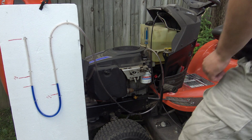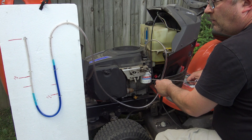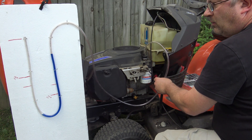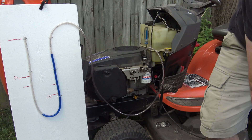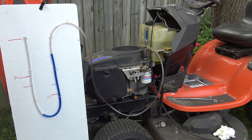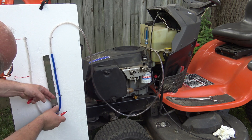Then we run the engine. First, very important — pinch the hose so it cannot suck when you start the engine. Now I release. There we have it — the crankcase has a vacuum and it's sucking on this water column. I need a measuring tape to measure how much it is. The engine is running at idle right now.